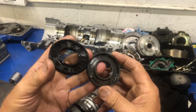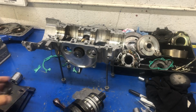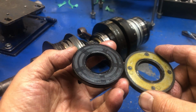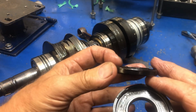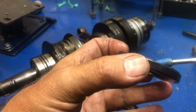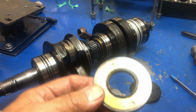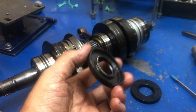But when we look at everything about this, it's just not the same. It's just cheap garbage. Use the good stuff. It is an airplane. So here's the economy rubber versus the real Rotax aircraft seal. There's visually quite a big difference in these. Of course, we don't have any kind of Teflon at all on the lip here, and we definitely have that brown Teflon on the real seal. To me, it's just so much of a risk to use cheap stuff when, yes, the appropriate and correct seal costs more. There's a reason that it costs more, because it's actually better.